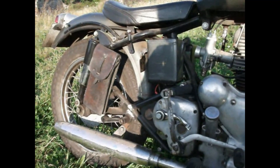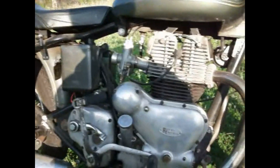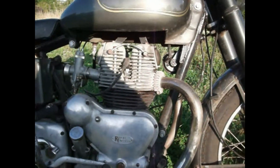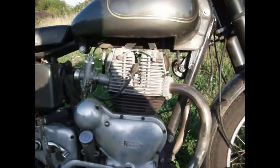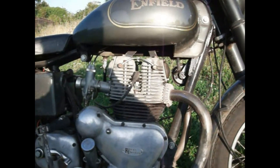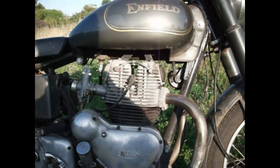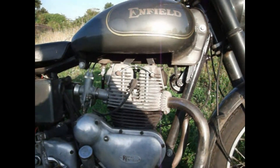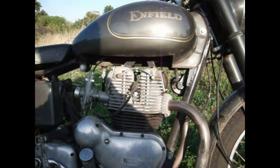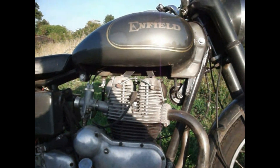I've put softer springs on it because it was horrendous — it would throw you over the handlebars if you hit a pothole. Real bone-jarring stuff. So what about the little old Meteor Minor engine? It's not the first parallel twin Royal Enfield made. They made a model before called the 500 Twin. It had a long stroke and narrow bore, so it was quite ploddy — but still a fast little bike. Then they brought out the Meteor Minor, which had the opposite: a bigger bore than stroke, so it was quite a revvy little thing. It's a wonderfully smooth engine when you're riding it — it's as smooth as the modern Interceptors.